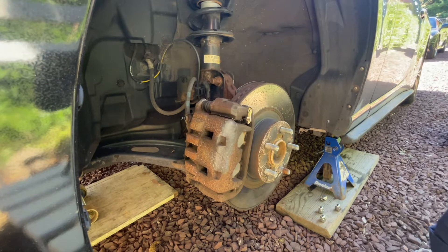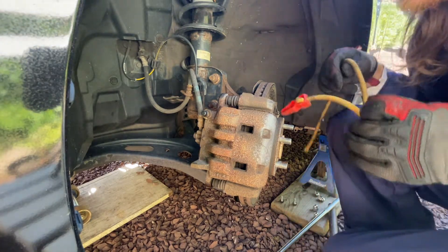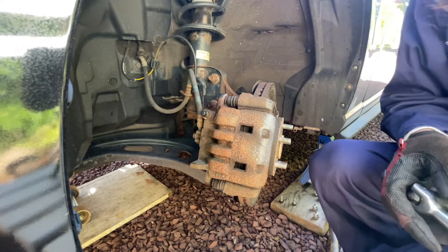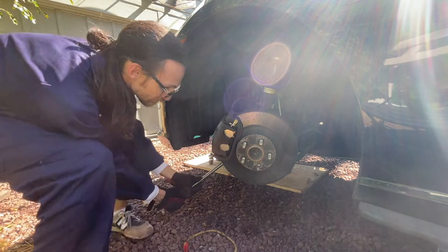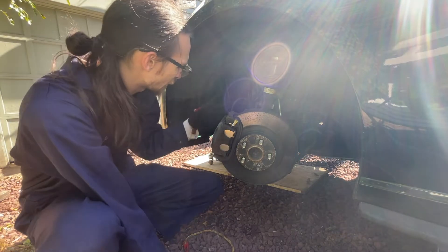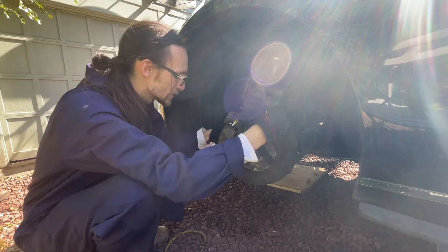To make your life easier, once you have the wheel off, go ahead and turn the wheel to the side you're working on. Now we move on to the caliper mounting bolts — this is a 17 millimeter bolt and it's usually pretty stuck. I can't get my impact wrench on it because of the strut, so I use a breaker bar and a hammer. I got an impact socket on there — pulling up on top and same thing on the bottom. Now I switch over to the ratchet. With all the bolts loosened, we can pull the caliper off of the rotor. Once you do this, have your bungee cord ready so you can hang it. Set the caliper up and away so you have room to work.